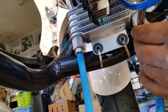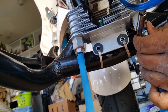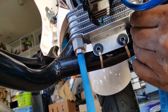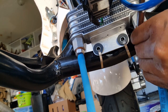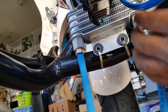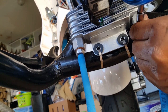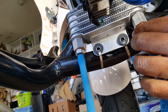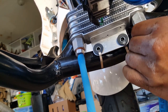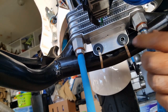I'm going to come from an angle where I feel like I can grip this and at the same time support it. When it gets to a certain point it won't let you twist much more. I hope the socket hasn't changed. Yeah — it looks like this thing is bulging out where it pushes the socket out, which is a good safety feature. Yeah, this is definitely tight — oil should not be leaking out through there. It's crushed with the copper washer — see that.